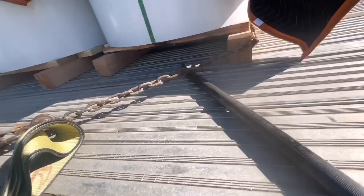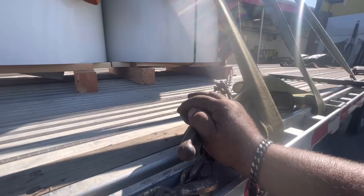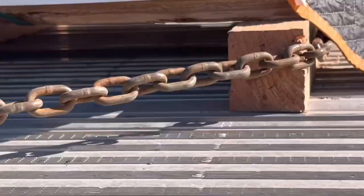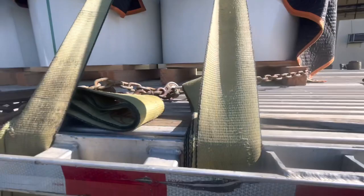Our trip chain is installed. Josh got it all binded up. So you got your binder here. Remember guys, this is not a securement device — this is just a safety restraint. So you don't have to go crazy tightening down on this thing. It doesn't have to be crazy tight. You want it to be good and snug to where it's not going to vibrate, and see how it's going to dig into the pallet a little bit. Keep a check on this guys — same thing when you check your straps, you want to reach up under your tarp, feel this thing, make sure it's not loose. If it's loose, you need to lift your tarp up and reset this.